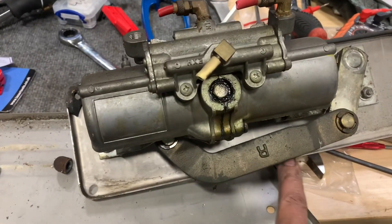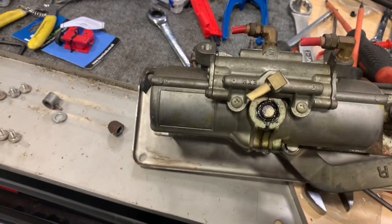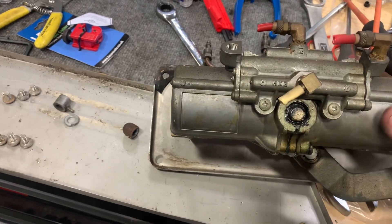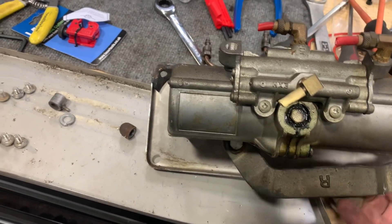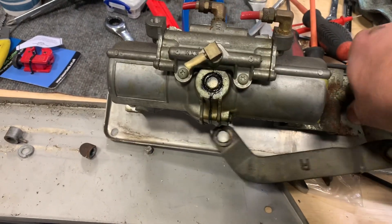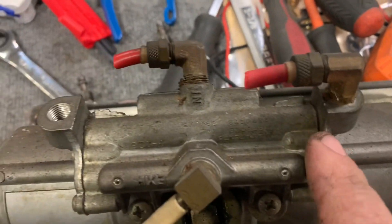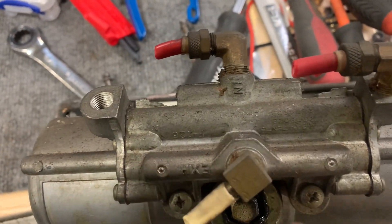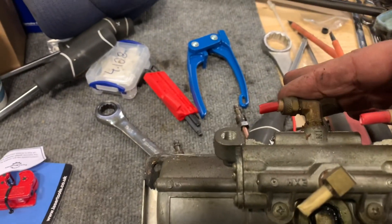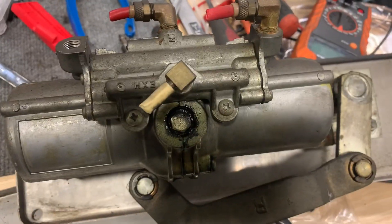This is my air wiper — 'R' for right. The idea is that this piston moves back and forth, and when it gets to the other side it reverses direction and goes back. I can tell from feeling this that there are absolutely no seals — they're shot. It just moves without any resistance. This valve actually tells the piston what direction to go. So this is the drain line, this is the inlet, and these two are exhaust. I'm going to get this sucker torn apart.